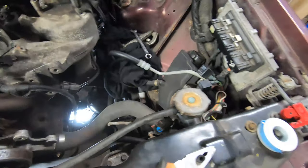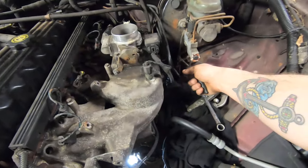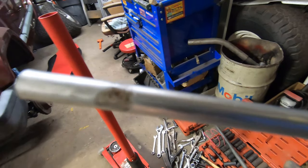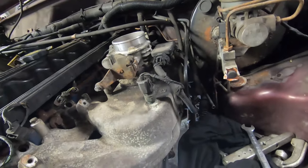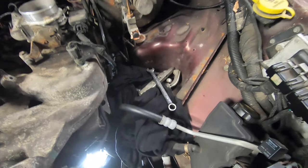It seems like this Jeep just keeps on fighting us, because as I was putting it together, my brother had the key on, so the steering wheel wouldn't lock, and it must have turned on the fuel pump, or the fuel line, and this guy started spraying out a little. If you see right here on the hose, I cut it already, the hard line. There must have been rubbing somewhere, and there was that little bracket that bolts it to the intake manifold. I'm assuming that's what it rubbed on, and there was a little pinhole spraying gas into the shock tower.